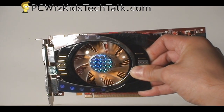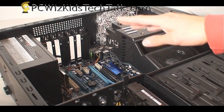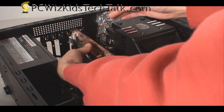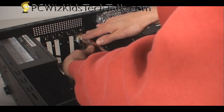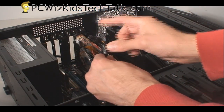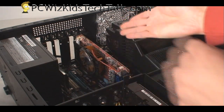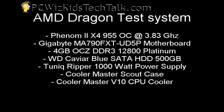When you go to install this, it's nothing special — just like any other video card, it's straightforward. Just make sure you have the power connectors disconnected and that you're grounded. Touch the case and install it in the PCI Express 2.0 x16 slot on your motherboard. Then find the appropriate 6-pin PCI Express power connector and connect it, and attach the screw to fasten the card to the case.